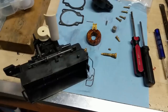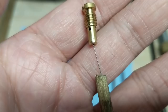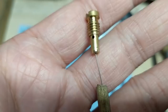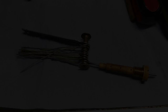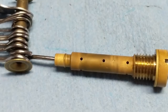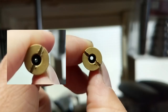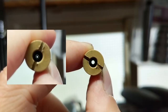I have a little tool here — a piece of metal wire that came off a wire brush. These hardened steel wires are small enough to poke out the very small hole in the pilot jet. You just poke it through and make sure you can see the wire through the hole — that means it's clean and free of debris. You also want to make sure the hole in your distribution tube is cleaned out. I like using oxy-acetylene tip cleaners because they come in all sorts of different sizes, so you can poke out the main hole and all the smaller holes down the emulsion tube. You can now see the hole is much bigger than before — the engine was getting less fuel than normal, and now it's fully cleaned out.